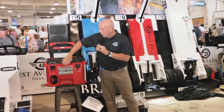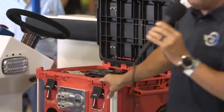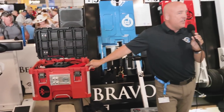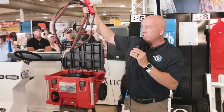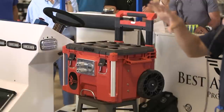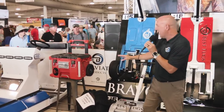This start pack is completely waterproof. The Milwaukee case is stronger than a steel box and costs about $300, but it's far better than bent metal. Packed inside are jumpstart cables that can handle all the amps, which plug into the front. The charge controller individually charges each set of batteries — because if your batteries get out of balance, you replace very expensive batteries fast. Once a set is fully charged, it turns off and keeps charging the lower batteries. That's another thing that makes us superior.